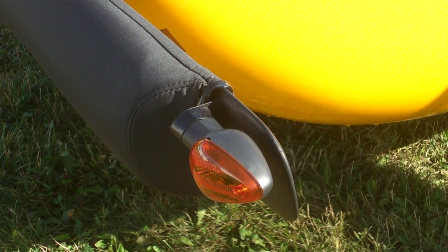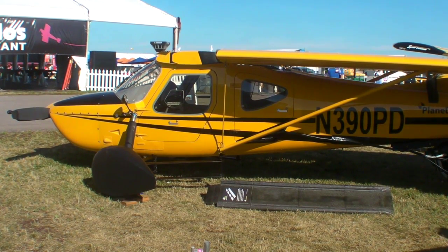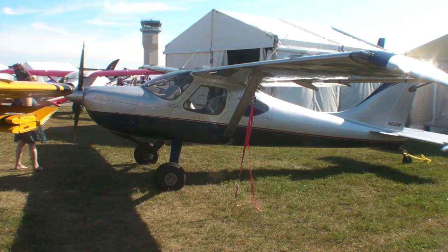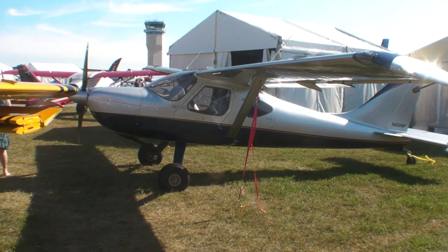We think we'll want to soften it up a little bit just to have a little more room, but the ride's very good with the long wheelbase and the good suspension. The height change is about a foot between the drive mode and the flight mode, which gives a dramatic change. We've maintained the stock prop clearance in the flight mode, so the plane looks pretty much like that stock sportsman right there in the flight mode. And of course we're very low here in the drive mode to keep the CG low and increase the stability.